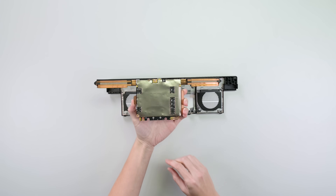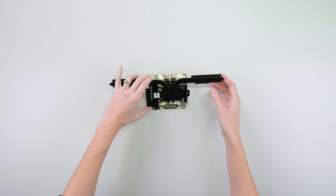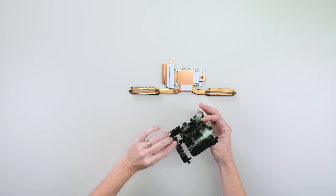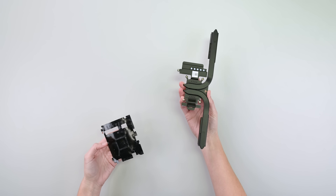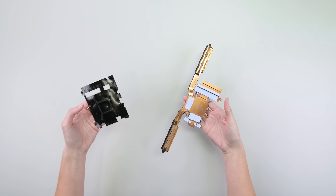Out comes the board, and yeah, this is a monster. Loosening the once again labeled fasteners and peeling it up from the thermal pads — this is a huge heatsink assembly, plus some super thick thermal tape. Together, there are 150 grams of passive thermal management. That's almost half the graphics module's weight. That's some serious heatsinking.